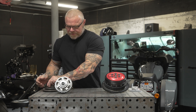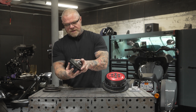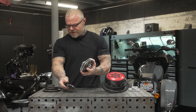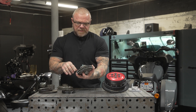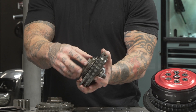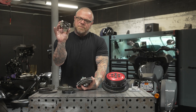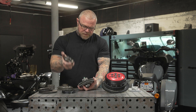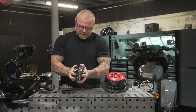The Baker compensator works very much the same — it's just designed a little bit better and designed for more abuse. So instead of all these loose bell springs, you've got one built spring pack, similar design where it splines onto the output shaft of the engine. But as you can see, this is a much more stout component. These don't break. We install a lot of these here because we do a lot of high output builds and I have yet to have one of these fail.